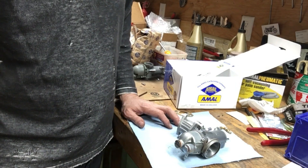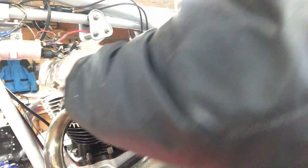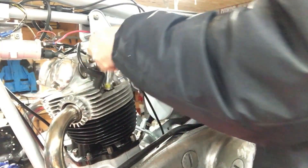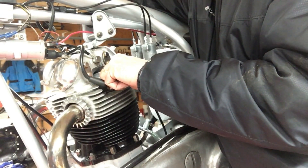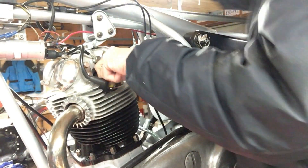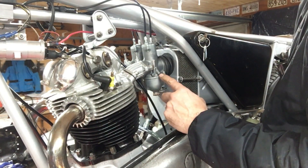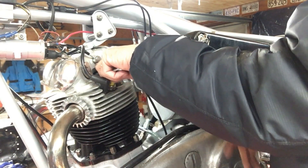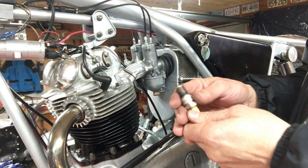So I'm going to stick these new ones on. Let me get these back on and set up. Got the carbs all back on — balanced them, set the idle circuit. What I do is I set that idle screw so it's just touching the slide on both sides, then I turn it in one full turn, and that should be pretty close to idle. We'll find out tomorrow. We're going to replace these plugs.